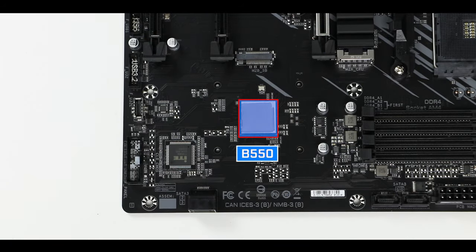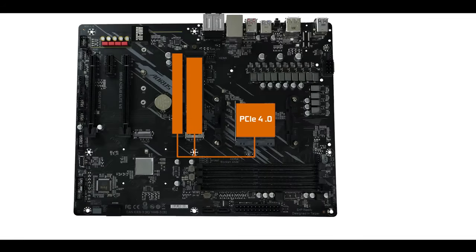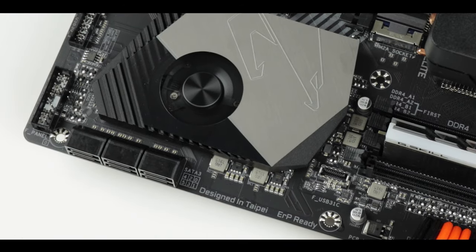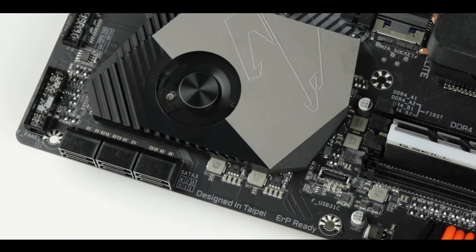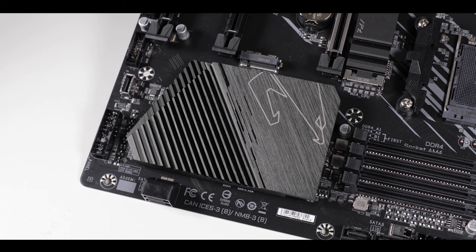Taking a closer look at the B550 chipset: since the CPU handles the PCIe 4.0 heavy lifting to feed our most performant components, the chipset can comfortably remain at PCIe 3.0 standard without slowing down your build. This also means the chipset runs much cooler — 6 watts instead of 11 — so no more need for a fan to keep it cool as seen on the X570 variant. As a result, we have PCIe 4.0 enabled on the motherboard without incurring extra cost from an active cooling solution — a balanced act that the B550 allows Gigabyte to achieve here.